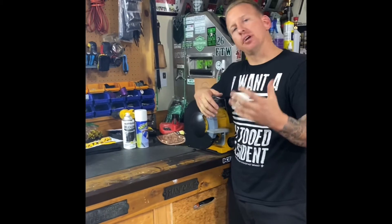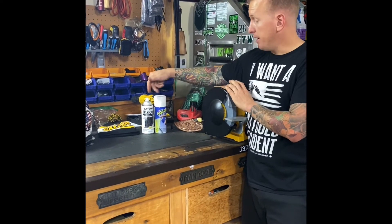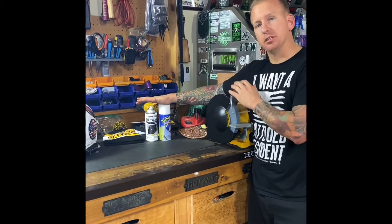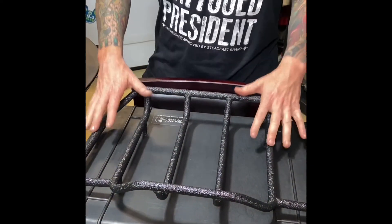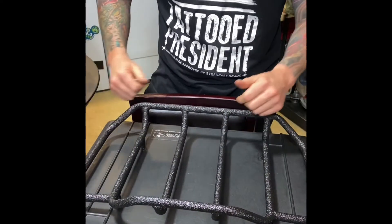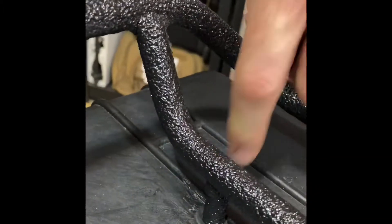The next step is the potential mount of the top touring pack rack that normally comes on Harley-Davidsons. For this one I'm using Plasti-Dip — this comes in clear, and there's also Flexi-Dip from Rust-Oleum which comes in black; they both come in clear or black. I took the stock rack and had it Line-X'd so it's durable and subtle, not chrome. Powder coating works too, but this seems more rugged and can get hit without chipping as easily. When I mounted this I drilled the holes to match the hardware, and then we put the rubber gaskets to start the sealing around there.